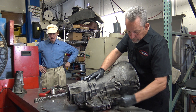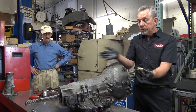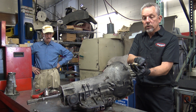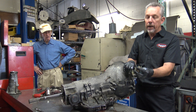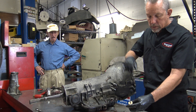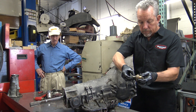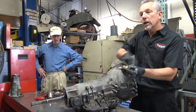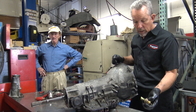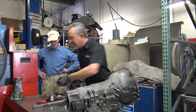A real common problem: there's a rubber diaphragm in here that keeps the fluid from coming in, and this goes up to the engine, and there's a spring. It's got a calibration — there is an adjustment on some of them. But one common problem, if you get a lot of blue smoke out of your car, is a broken diaphragm in here. It's sucking transmission fluid into the engine. It cleans the engine really well, but it smokes. It is unattractive.